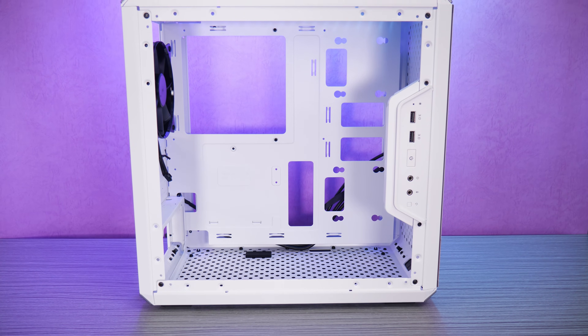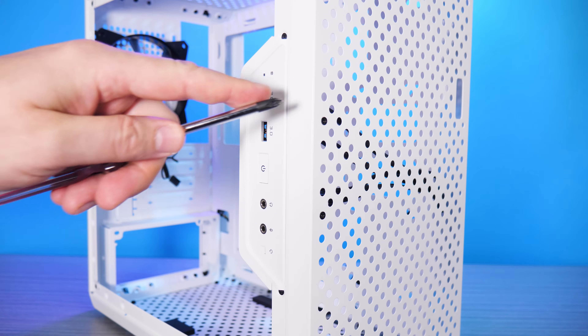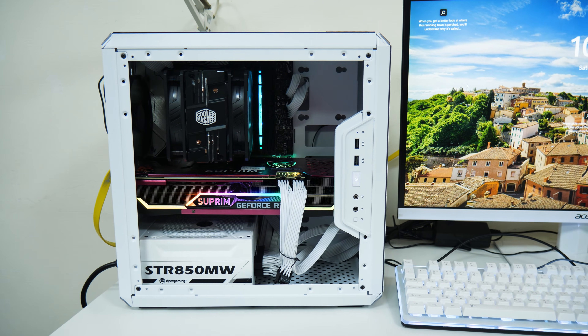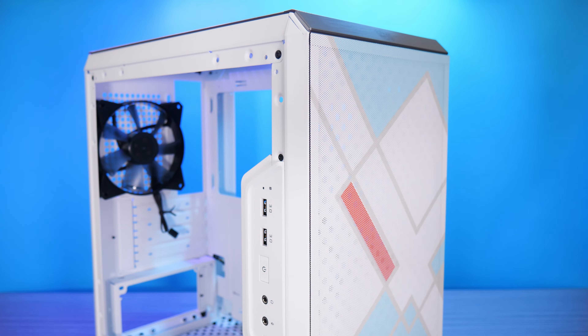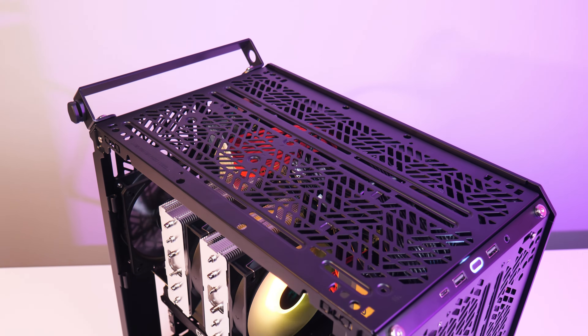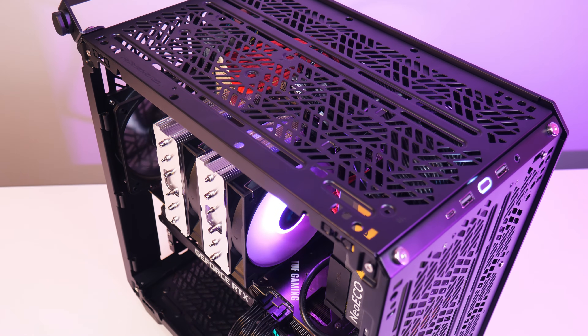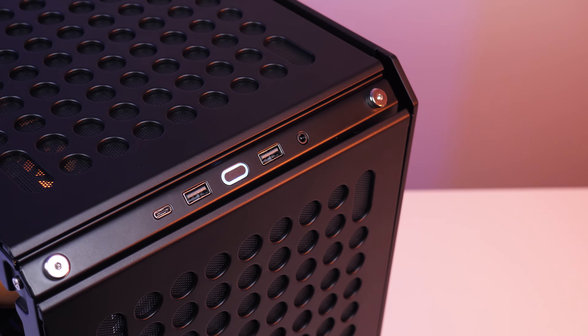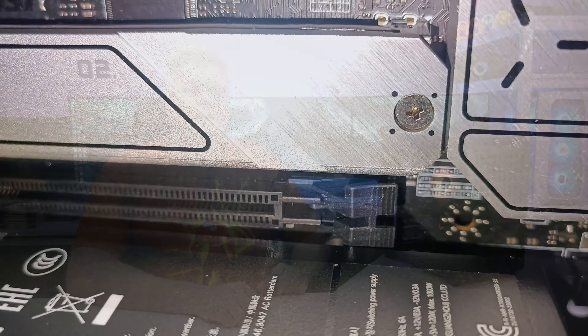We roasted the Q300L because the panels didn't allow sufficient airflow. The non-removable panels with the extra interior flange made even a 300mm GPU installation hard — I had to remove fans and front IO so many times to troubleshoot, wedge in the GPU, and fit components. Non-adjustable case fan locations made top mounting and AIO impossible, and rear IO covers were bend-off, which are terrible. Before taking an angle grinder to it, it was an oven. The Cooler Master Cube 500 vastly improves on this and building with removable panels is far easier. But we lost a reset button and the ability to put a PSU at the bottom, as it blocks headers and touches the x16 slot tab — this was obviously an afterthought.